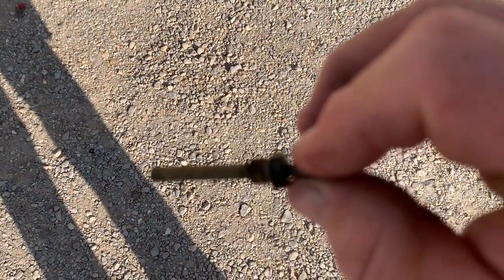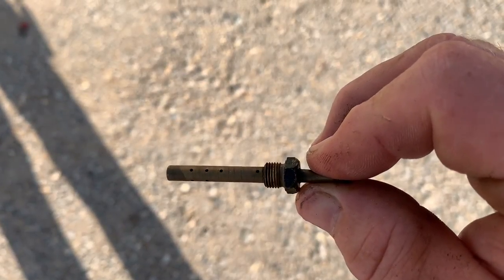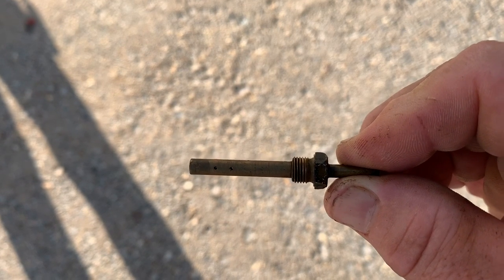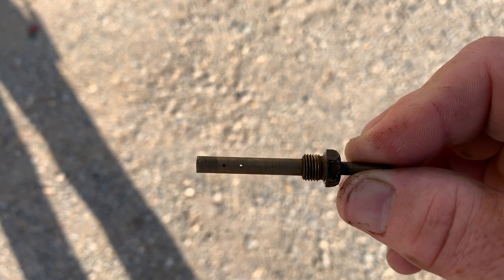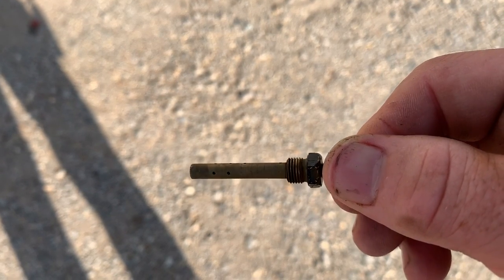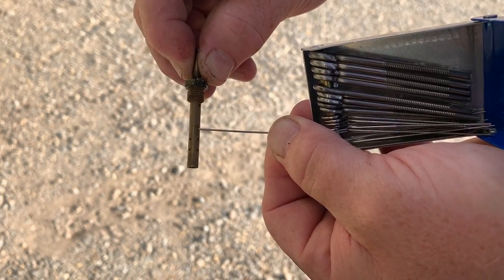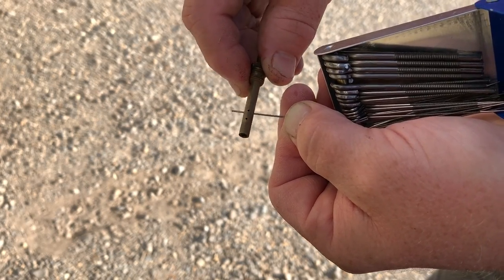When you look at the jet, you've got little holes. Let me try to focus in. You can see through the holes on some of them, but some of them are hard to see through — that's because they're partially stopped up. What we're going to do is take a tip cleaner and rod all those holes out so the fuel can make it through into the air mixture. A guitar string will work, or a wire brush poking wires through it will work. You want to clean all of the holes.